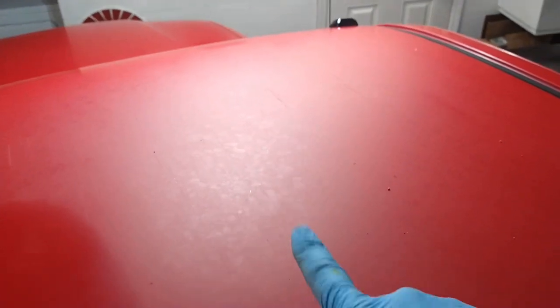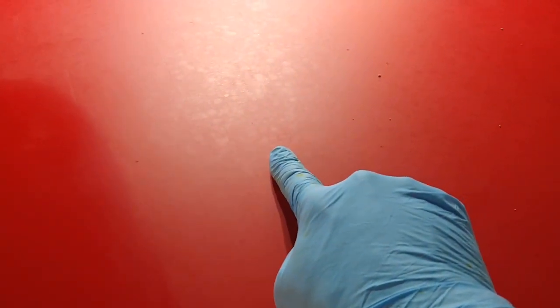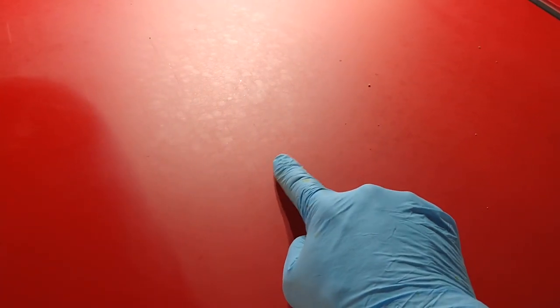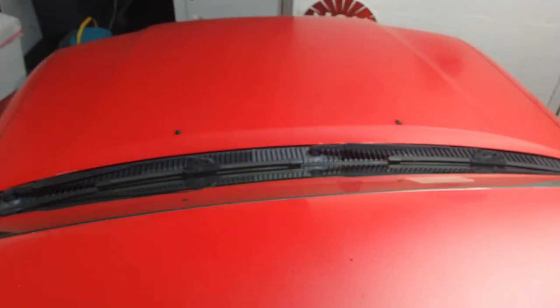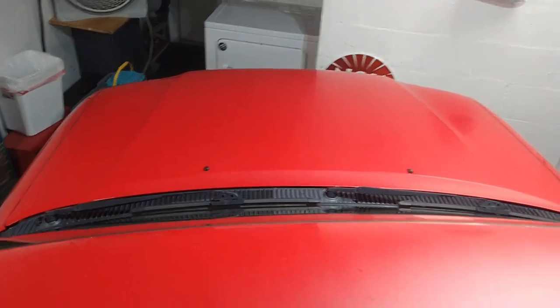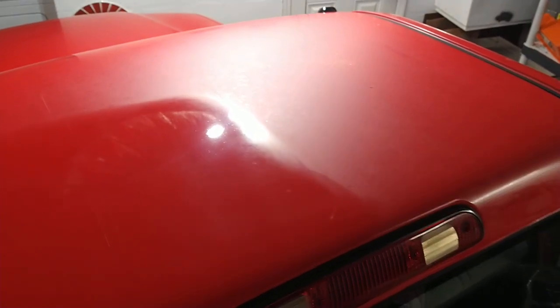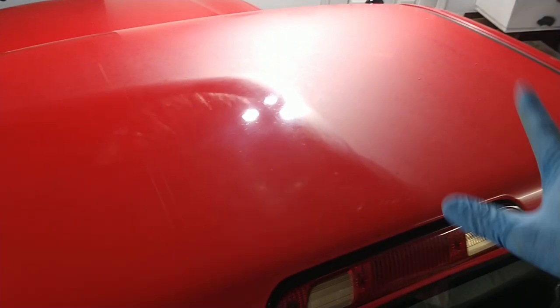The client called me. The paint is very faded — it sits outside. It's red. Red is a tough color. Like all dark colors, it absorbs a lot of heat and it fades, and you get this hazy look. You can see the hood down there is the same exact way. So after a thorough wash, a clay bar, iron fallout remover, and some panel prep to make sure I've got a nice clean surface...